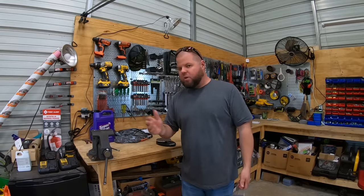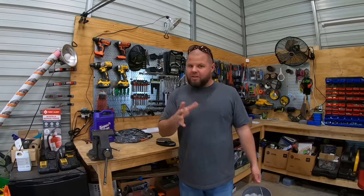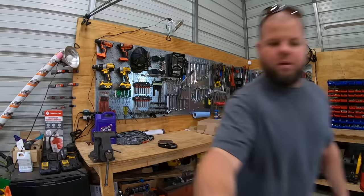And most refrigerator models say 3 to 4 pounds. So this is right within spec. Now being this is the first 24 hours I've run it, it could get up to that 4, 4.5 pound mark. Let's talk about that.